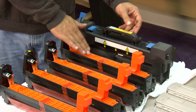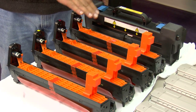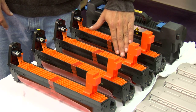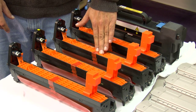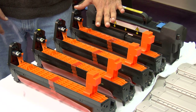Next we've got four image drums, one for each color — cyan, magenta, yellow, and black. The print head fits behind the image drum and it commands the image drum where to deposit the toner on the page. Seeing that this is an LED single-pass printer, all four of these drums are depositing toner at the same time.